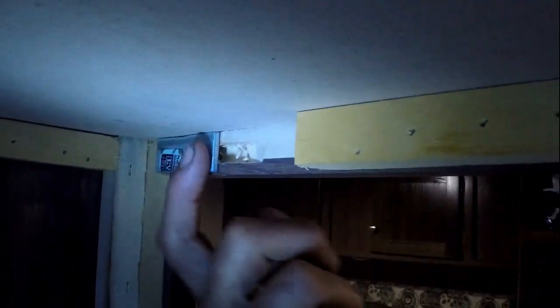It's been a couple of days, the silicone has dried, and we're ready to put this microwave back in place. As you can see, there's that bracket — put it on with the silicone so it's not going anywhere. I went ahead and cut that one screw down so it wasn't pressing up the sheet metal, got it pressed down and back in place. Got that fixed too at the same time.